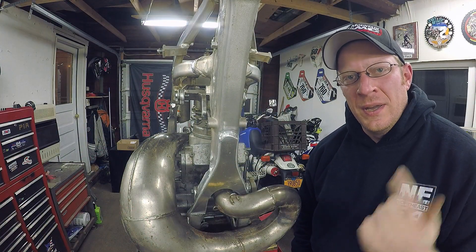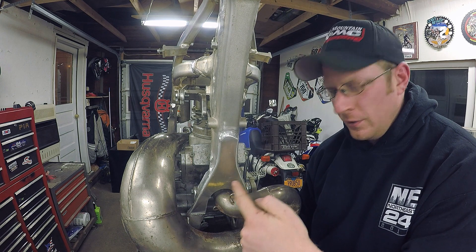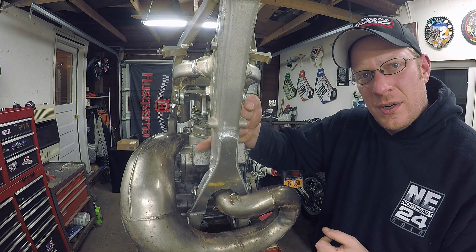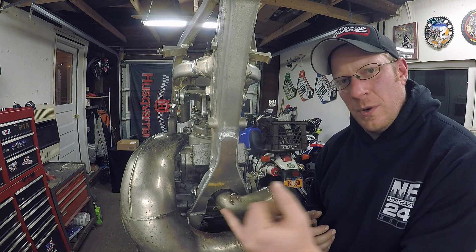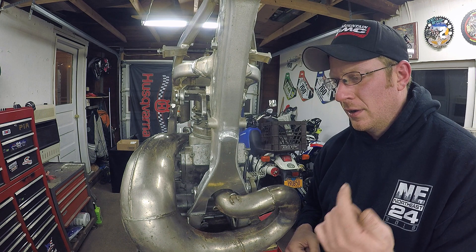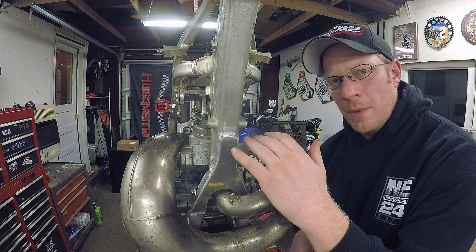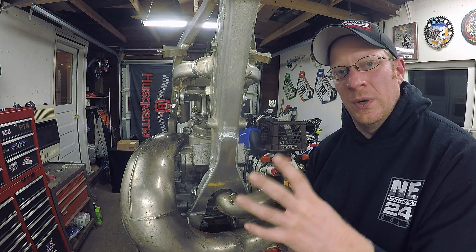So I took it there and this is pretty much what we came up with. Now the big elephant in the room is how the hell do you get the two-stroke pipe to fit in the yoke here, because it's a lot further down — the four-stroke pipe comes out of the side of the engine. I talked to this guy Brandon Kentner, who pointed out that he actually cut the Y on two different frames and moved them up, and both frames cracked because of the casting and the aluminum it was welded with.